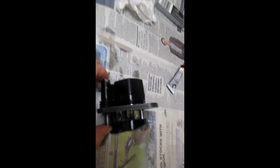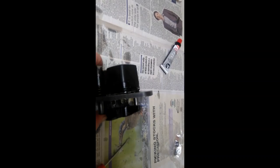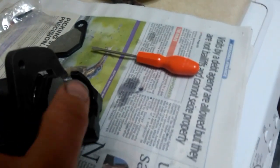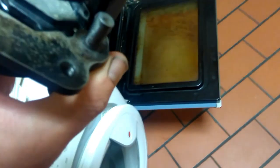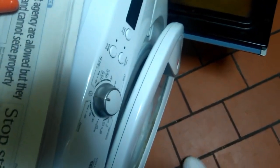What I have now is holding onto one side of the caliper with a nice springy action. If I can't get my brake pads on now, I may as well give up. So after I put the anti-rattle spring in, this first pad - it's difficult to explain how it went in - the aperture is just right for it, so you just squeeze it all the way in and press it in. The low light in this place just doesn't help. It seems to be held in there, which is kind of disconcerting.